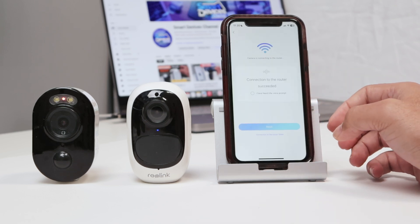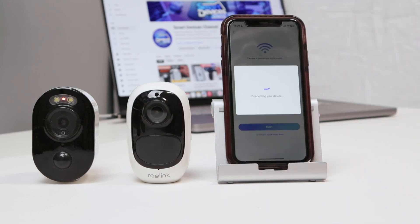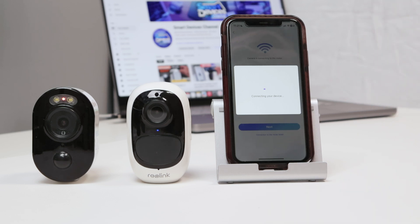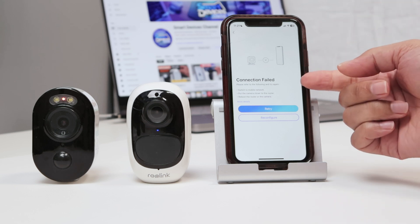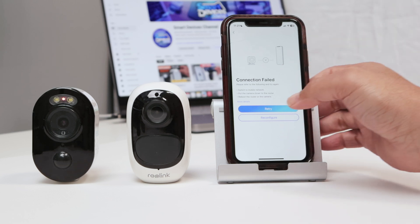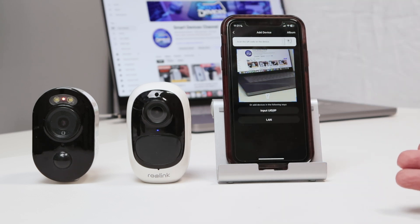Click here and next. I heard the voice prompt, or at least the sound from the camera. I click next and now it's trying to connect to the camera. I will probably have a hard time connecting because I'm trying to use the repeater. So if it doesn't work, I need to restart my repeater or try a different Wi-Fi — if you don't have more than one, just restart your router and try again. That's the problem I have here — it's not working, I see this message and hear the sound indicating failure. I click reconfigure and come back to the first stage, and I hear the sonar sound. If I don't hear this, I need to reset the camera again.